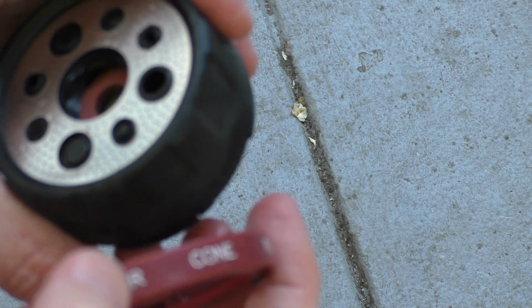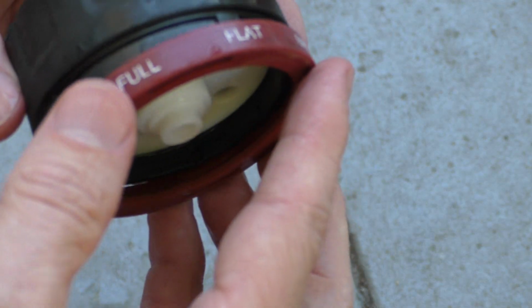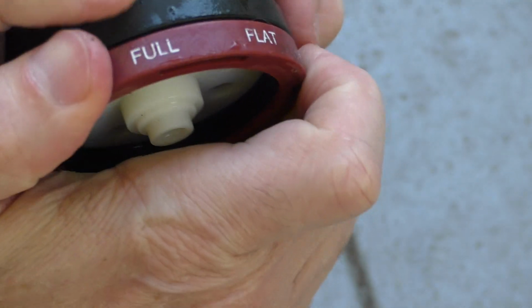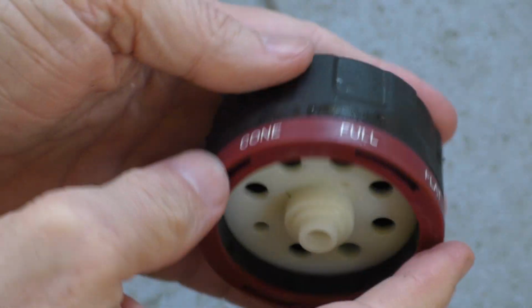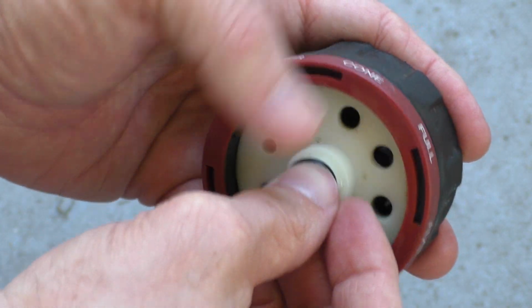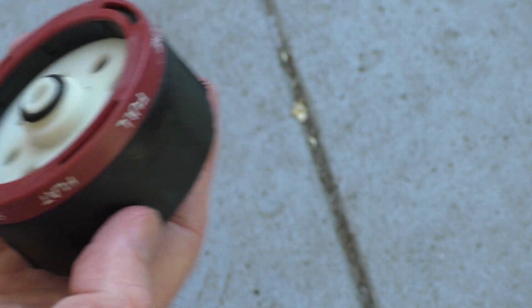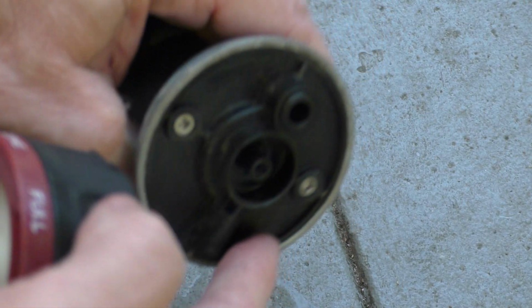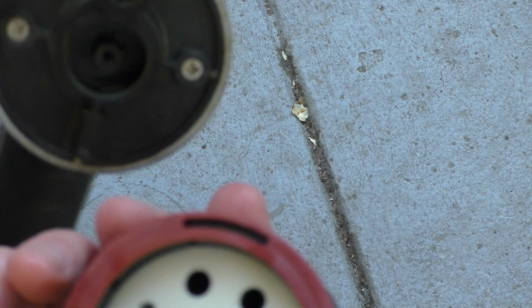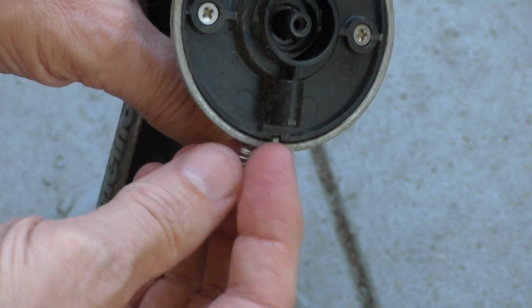And now to replace the red retention ring. It should only go in one way, but you do want to make note of the labels and which nozzle it belongs to. Just replace it and tighten it clockwise. Don't forget to replace the O-ring on the pattern head. Now reinstall the pattern head onto the nozzle itself. Don't forget about the little spring with that little tip. You do need to replace that or you won't hear the clicking sounds when you rotate the head.